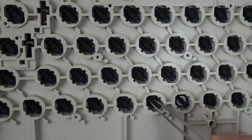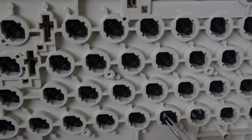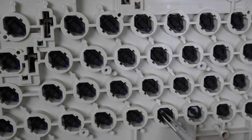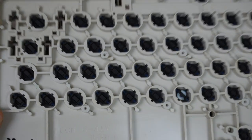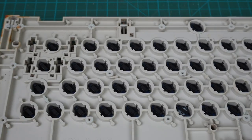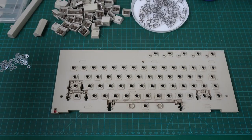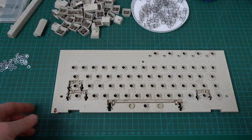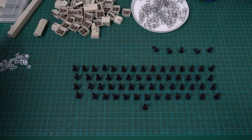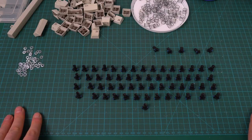Let's just do the rest of the keys right now. I was trying to figure out a way to do it without having to take out each key from the other end, but it doesn't look like it's possible. So I'm afraid we're just going to have to pop each key out of here, take out the plunger, and put in the washer. In the end, I decided it would be easier to just remove all the keys, put in all the washers, and then put all the keys back together. So there they are, nicely aligned. Now I just need to put the washers in all 62 keys, I think.